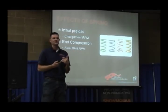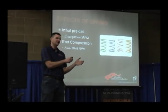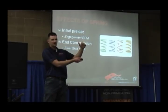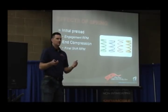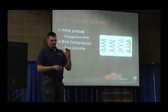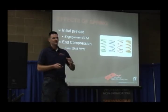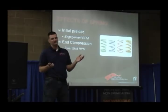On our springs, we use the Polaris method, but I've measured them all using Arctic Cat's method as well so I can say this spring is equivalent to Polaris's almond red but also equivalent to Arctic Cat's white-yellow. It's not as easy to convert them over to Ski-Doo because Ski-Doo uses much stiffer springs in general, but the same theory applies. The final rate is obtained by compressing that spring down to basically spring bind — it can't compress anymore. That second rate is usually about 1.25 inches; Polaris goes 1.19 inches and Arctic Cat is around 1.25.